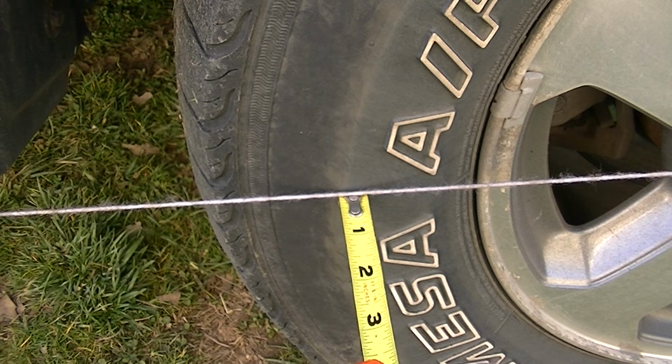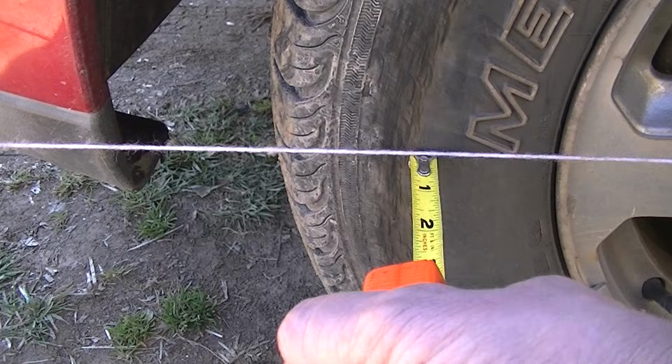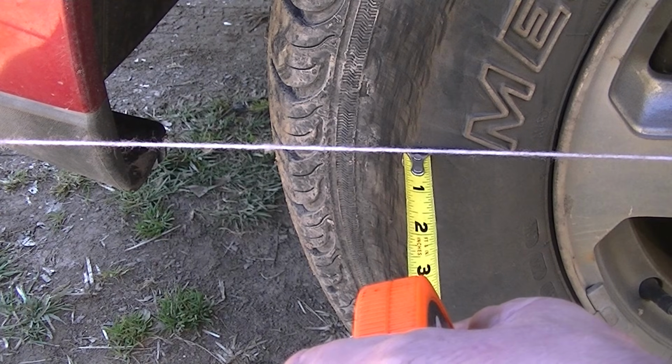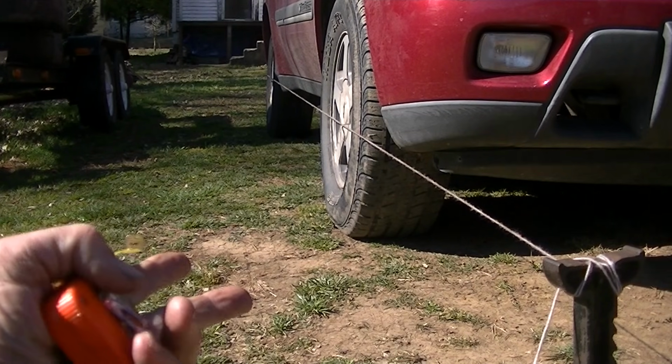And you take measurements from the back tire, and you do the same thing with the front tire, the back of it and the front of the front tire. And you get the measurements pretty close. And obviously on the front you want a little bit of toe in. But there are hundreds of tutorials online about that. And basically you do the same thing on the other side.